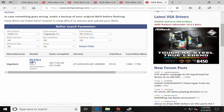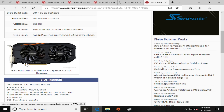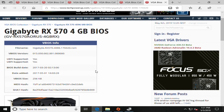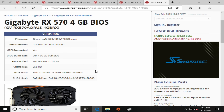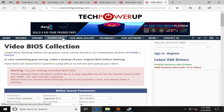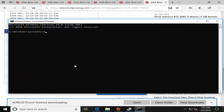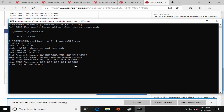To get around this, we go to the TechPowerUp VBIOS database and get the Gigabyte RX 570 gaming BIOS. I couldn't find the exact Gigabyte one, so I used the Aorus, which is essentially the same card. We then use a program called ATI Flash to flash this back to a gaming graphics card, and then hopefully the driver will install just like a normal card bought brand new off the shelves would. Otherwise, without the flash, it's essentially a useless card for gaming.